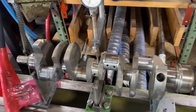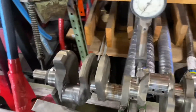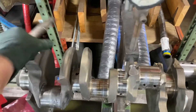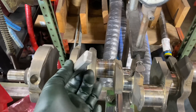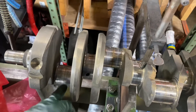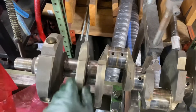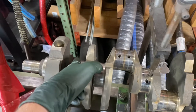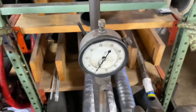The crankshaft is all straightened. I straightened it with this hammer and this peening chisel. Basically how it works — there's another video on this — you strike the radius with a couple taps on the low side. The low side happened to be right here, the high side was over here. It took me about five or six tries, just tapping lightly right in the radius, and that relaxes the metal.